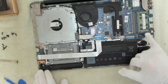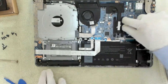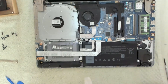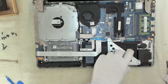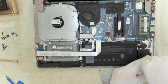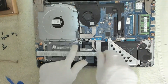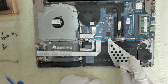So that's the device back together. As you can see, we've got 16 gig of memory on the right hand side, and we've got the ability to add another 16 gig if we need to — so there's another upgrade option. We've already done the SSD drive upgrade; that was a hard disk previously. Now we're going to reattach the bracket — I forgot about the bracket. The screw goes in here, and remember, it always pays to remember where your screws were.